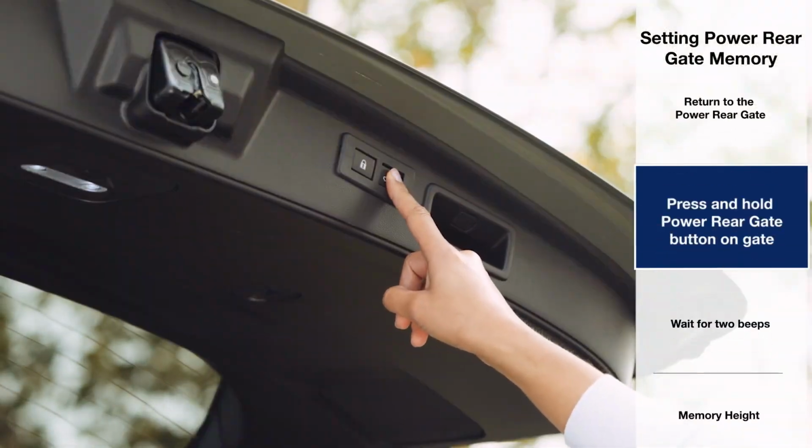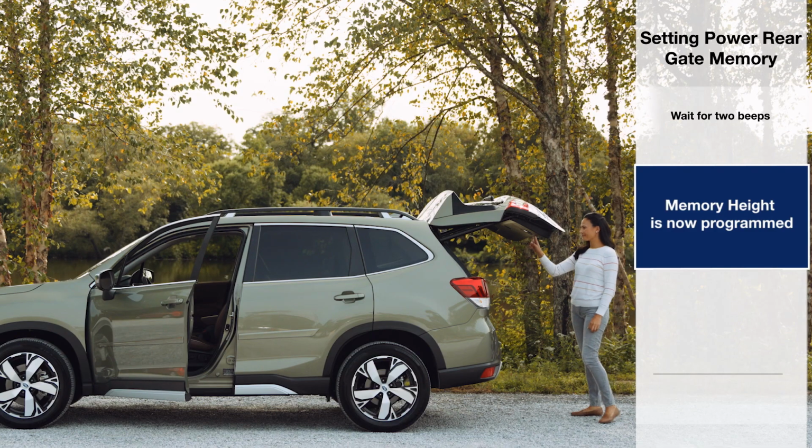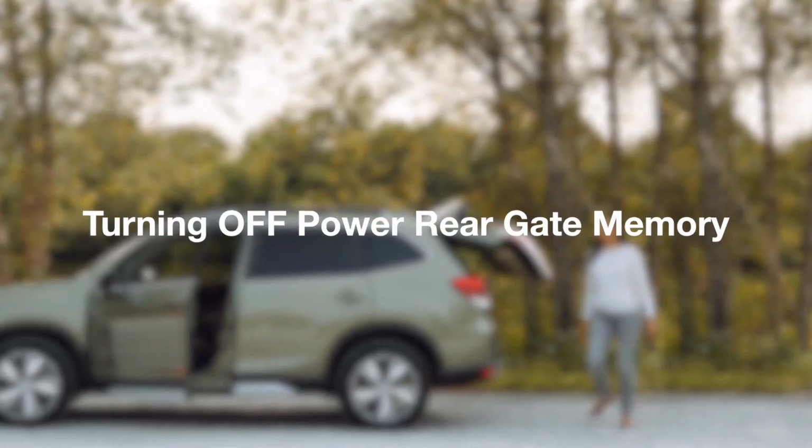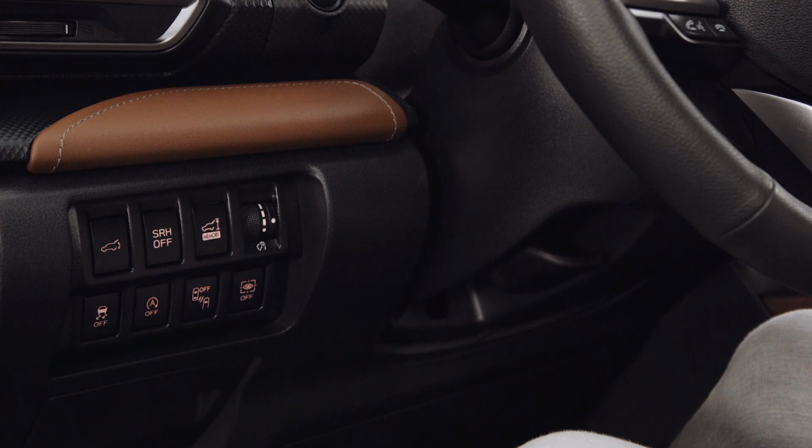Press and hold the power rear gate button on the underside of the rear gate until you hear a short beep followed by a long beep. The memory height is now programmed. You can turn the memory height on and off anytime by pressing the memory button, and you can reprogram the memory height by repeating these steps.